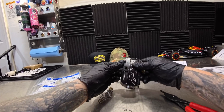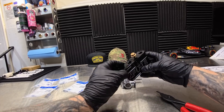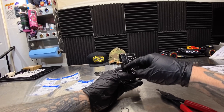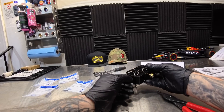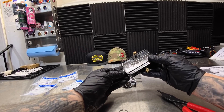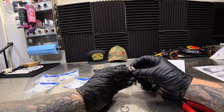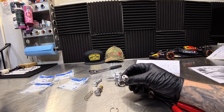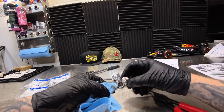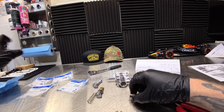So here in comes the PPE block right here. This bypass valve is just a straight-through design and there are a couple pros to this that I really like. One: it's a straight-through design so the fluid is going to flow straight through right out to the cooler. The other thing I like — and you can see I've used this before, I took it off during winter time and I'll get into that in a moment — it comes with this magnet right here, and you can see there's actually debris on there still. The magnet is doing a good job at grabbing debris that is passing through there.